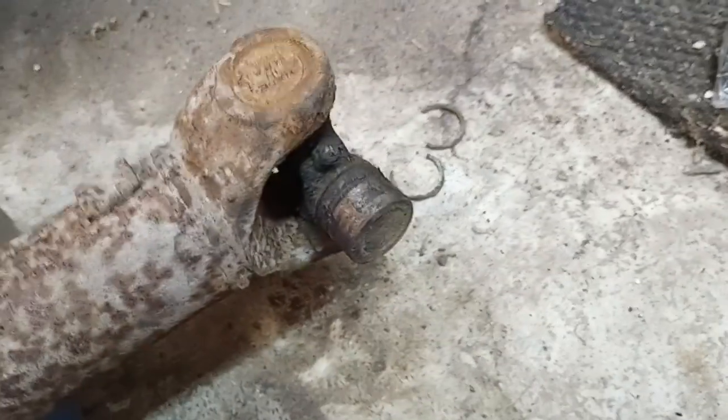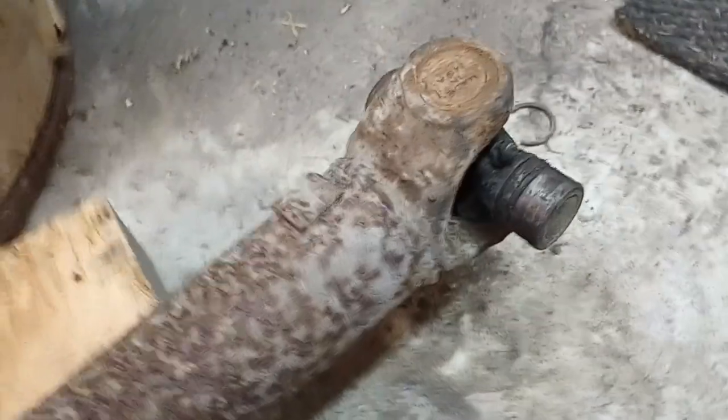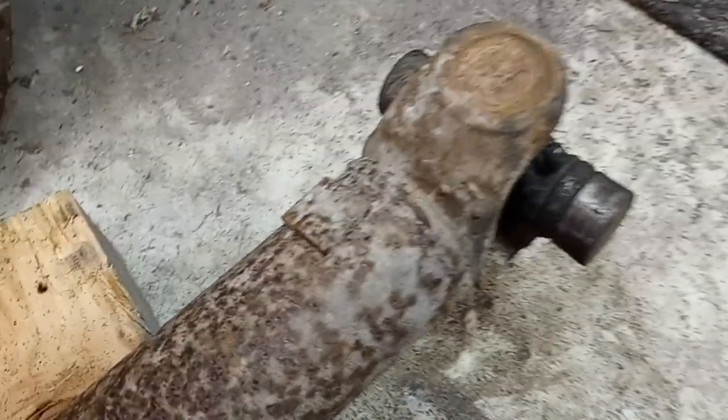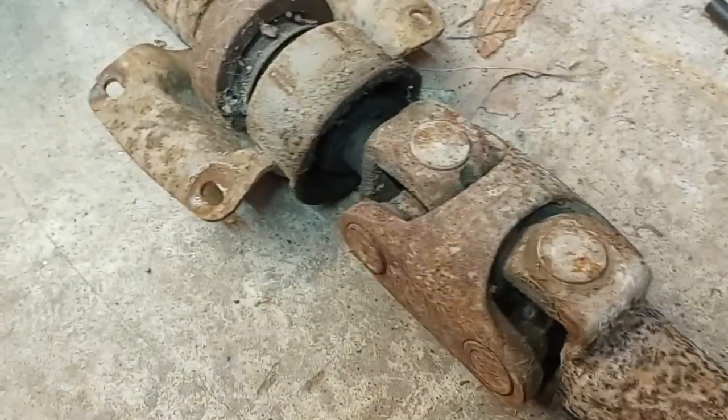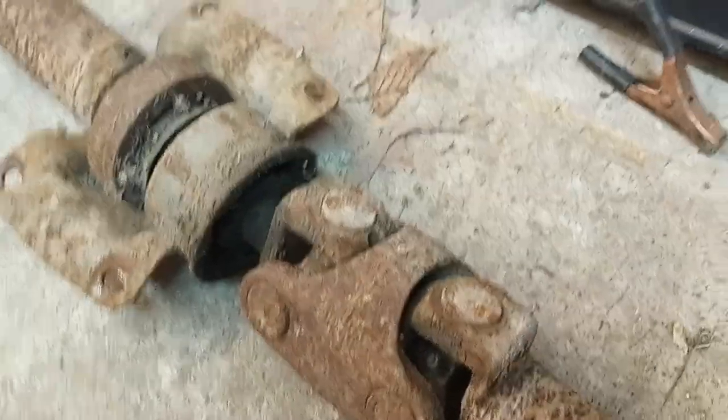It's a little rough, and I already have the drive shaft out, so I figured let's go ahead and replace it. Normally I use either my shop press or a vice to push out U-joints the normal way, but this thing being so long and they tell you not to put stress on the CV joint, it'll make it a little hard to get it into my press. So I figured I'll give this a shot.